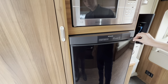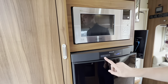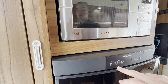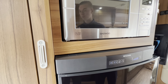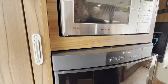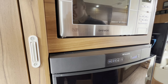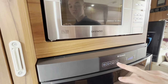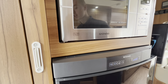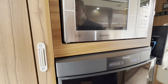To operate it, turn it on and you've got the choice of three sources. You've got the picture of a plug, which is mains 230-volt — if you're on a site or pre-chilling the fridge at home, pop it on mains and as long as the caravan's hooked up, the fridge will work as a household fridge. If you're wild camping, you'd use gas — make sure you've got gas on board, your bottles are turned on, and press the gas flame there and it'll self-ignite on LPG. Then if you're towing, you can put it on battery and your tow car, off its engine battery, will supply the fridge and keep it cool as a cool box until you arrive at your site, and then you either go back to mains or gas.